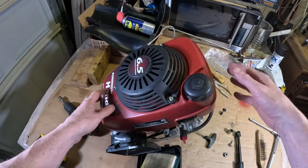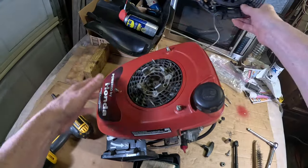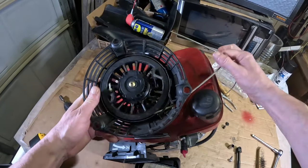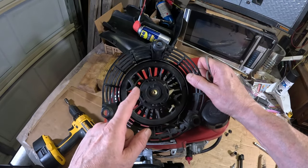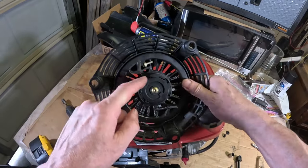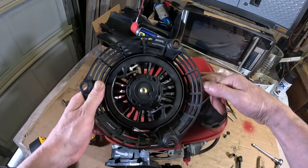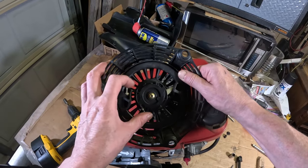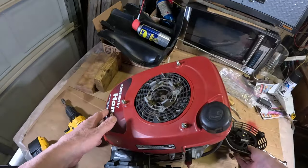We don't have any fuel in here, so that's a good thing — it's going to be a lot easier to work with, and changing the oil will be easier too. So we've got the recoil here. I do notice with these Hondas they have these cogs that come out — these are what grab the flywheel when you pull it, so I always make sure I lubricate those. It's got good movement. A lot of times these cogs will break — I actually have another mower where one broke, but surprisingly it still works with just one of them.